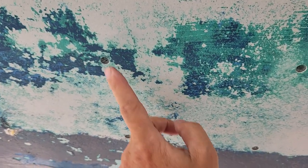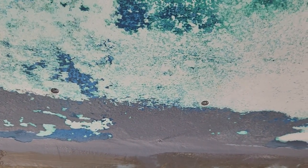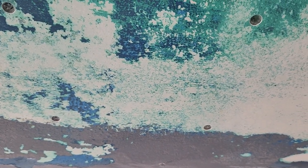I did a little research and the best thing I could find, other than tearing it apart or getting a different boat, was to drill holes — roughly every six to eight inches — with a regular quarter inch or eighth inch drill bit. It had separated: between the outer fiberglass surface and an interior surface, a gap had formed. So I drilled those holes and then used closed-cell spray foam to fill that void. Marine epoxy is another option, but closed-cell waterproof spray foam works great.